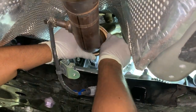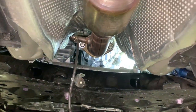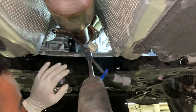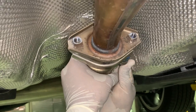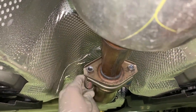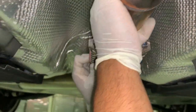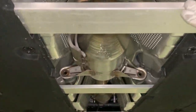On to the last step of installing the headers: reinstall the mid-pipe. Super simple — it does come with 14mm bolts, you do not use the original bolts that were on there. 2J Racing provides you with 14mm bolts; just snug them tight with an impact, electric handgun, or even a regular hand tool. Make sure you put all three brackets back on that are on there and she's good to go.